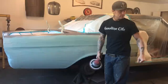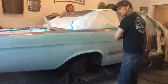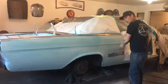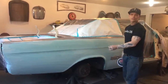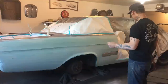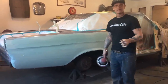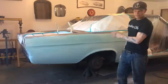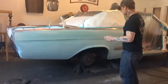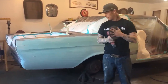I'm saving time because I realize that. I took my level, put it on there — it's pretty straight. I've got enough on everywhere; I might have to coat it again just because of pinholes and that sort of stuff. That's the way you do it. I didn't sand in between any of the body fills, I didn't sand the fiberglass — I'm going to sand it now. It didn't take me that long to put that on there.